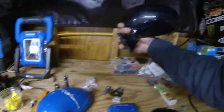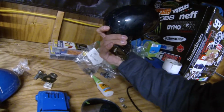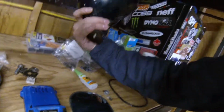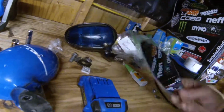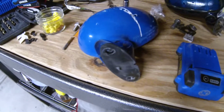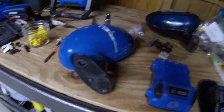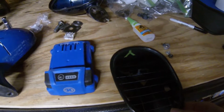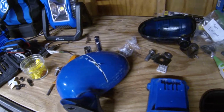Alright, so we got our case. This is a Montego Blue. I'm going to clean it up a little bit. This is from the crashed car, the driver's side that got hit, so it can probably clean up pretty well. It's color matching though. So then we got our glass. We'll put the glass in there. We got to get this ring off. This one's a little broken. And this is the good ring off of this mirror. I paid 20 bucks for that. They wanted like 15 for non-OEM ones on Amazon. So we'll go pretty much like that. Put it in there up against these rubber pads. We'll glue it together and then we'll put it on.